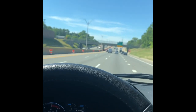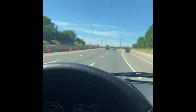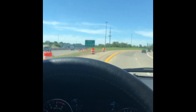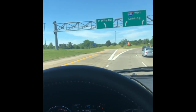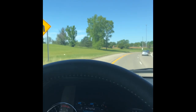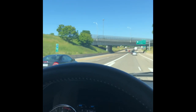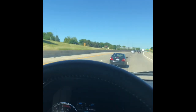When I was dinking around, when I was doing 50, the instant gauge was showing dang near 30 miles a gallon, and I believe that because I've had the truck almost 25,000 miles. I have checked the instant gauge, and I've checked it leaving it on and seeing the average. An average is a pretty easy thing to calculate. I have checked, first of all, the GPS is correct in terms of the speed. I use my Garmin GPS and the speed is correct on these tires, because these tires, even being 35s, are dang near the same diameter as the factory tires. What this truck says for average fuel economy is exactly what I calculated it to be. I think that they've got it nailed.